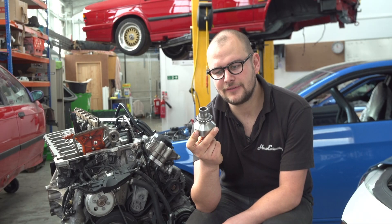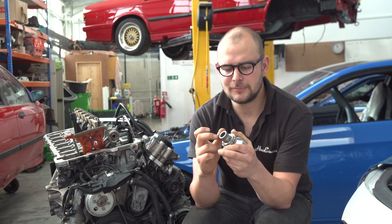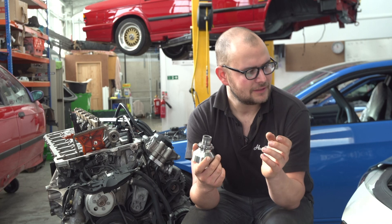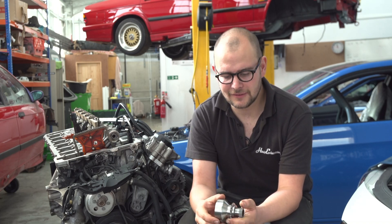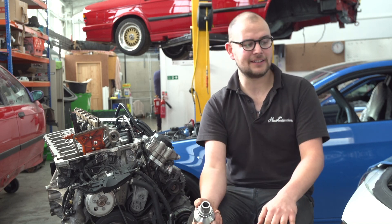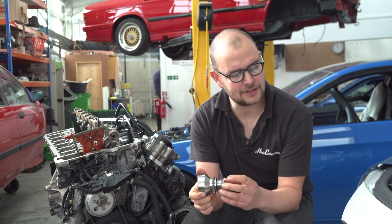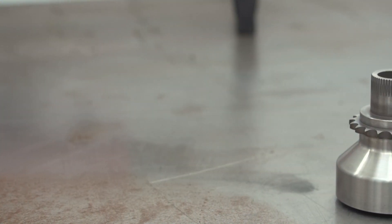This crank hub here is a Vargas crank hub — VTT for short. We've chosen these through quite a bit of research. A lot of options use pins, but in our eyes that's really just not good enough. Little pins like that are only ever for alignment purposes, not for strength, which is obviously what you're using this for. Also, the idea of taking apart a lovely S55, pulling all the front bits out, and then taking a drill to the front of the crank — whether it comes with a fixture or not, it's just hideous. You create weak spots around the front of the crank, and essentially all that's going to happen is if it ever does spin, you'll write your crank off rather than having some chance of fixing it. That's why we chose these ones — they're splined on the front, so they cut into the crank further in, which is a far, far stronger way of doing things. Once that's tight, that's not going to go anywhere. They're also easier to fit — it's just a big win-win.